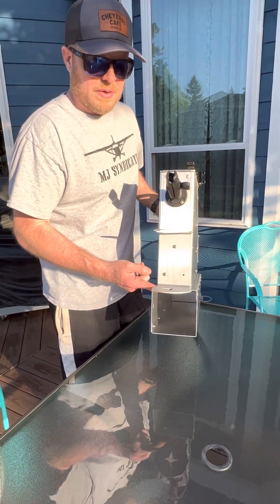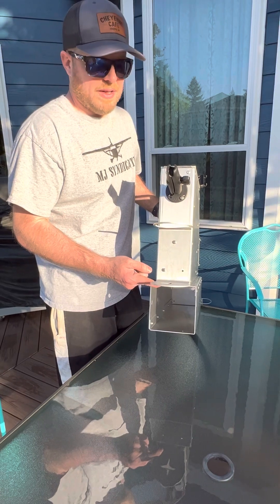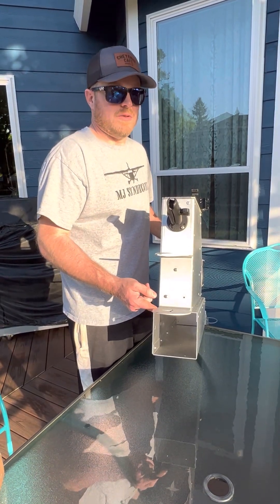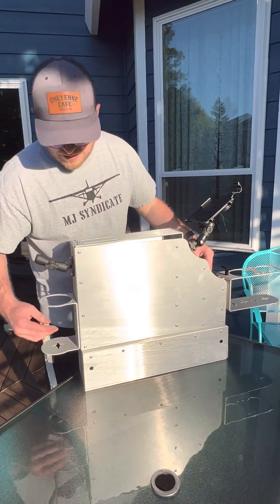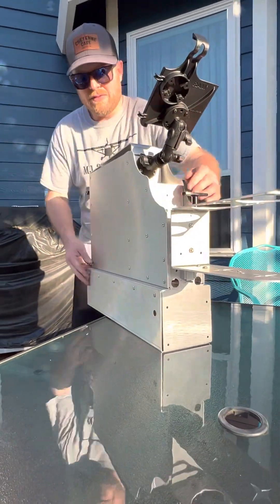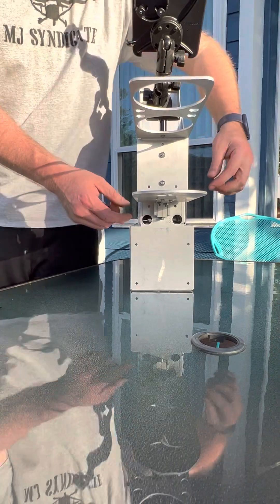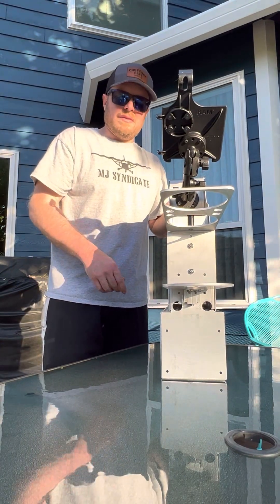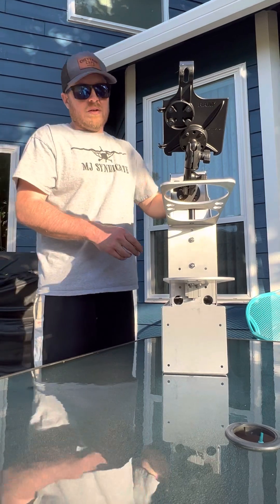The square tube opening at the bottom is where an O2 tank would go. It's a little bit smaller — and we'll talk about the size differences from the 182 straight-leg version — because there's less room between the seats on a 210, especially the 210 pressurized. It also has internal routing for your O2 lines and cannulas. They come in the bottom here, come up right below your cup holder, up to your co-pilot and pilot, so you're not snagging those lines on your seats. You can also run them on top of this little shelf.